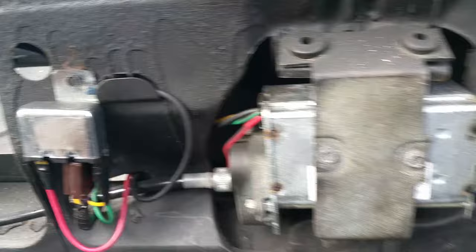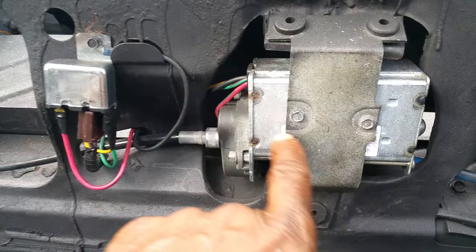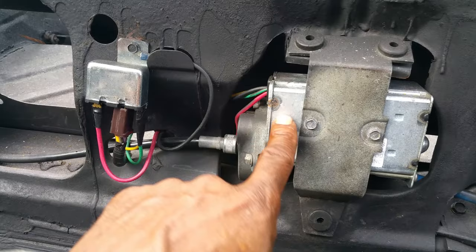That's basically what it is and how it works. If you have a problem with the top going up but it's easy to go down, it's probably a motor issue because it's harder for the top to go up than it is to go down because of the resistance. If you hear the motor running and you got a new motor but it's not working and the top won't go up, check the transmission gear — they might be stripped inside.